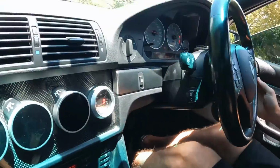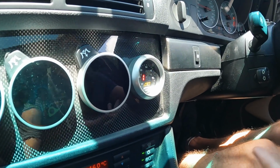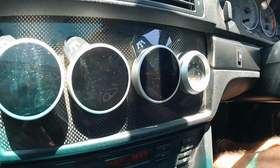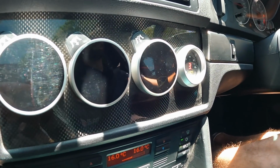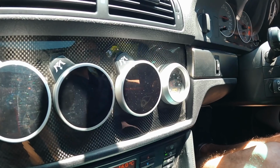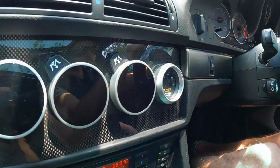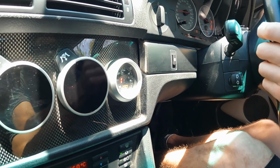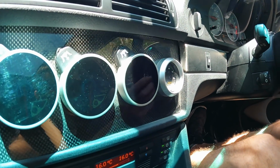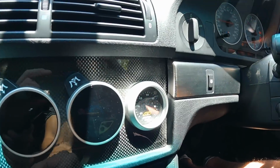Man, the engine is so responsive. That pulled well. Now, this is also the first proper drive with AFRs as well. Of course, we haven't actually been able to... We know it's rich, but never been able to see actually what it's doing. Considering your very light throttle, not under load, it's still in 13 a lot, and 12s. It's pumping the fuel through. Seems off throttle, it goes into 12, which is weird. Yeah, off the throttle, and it bang. I hope the GoPro's picking it up.